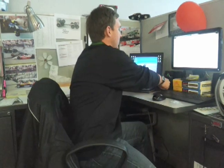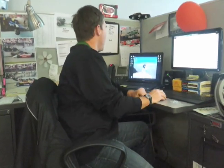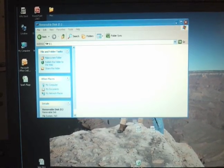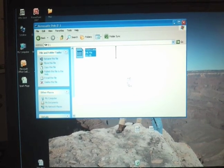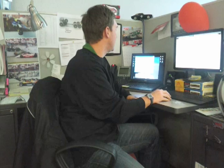When you download them, I suggest putting them right on your desktop so you can find them again. Put your micro SD card into a slot on the computer, and when it comes up, simply drag and drop the Atomic files into the SD card. No need to put them in a subfolder or anything like that — just right there in the main folder.